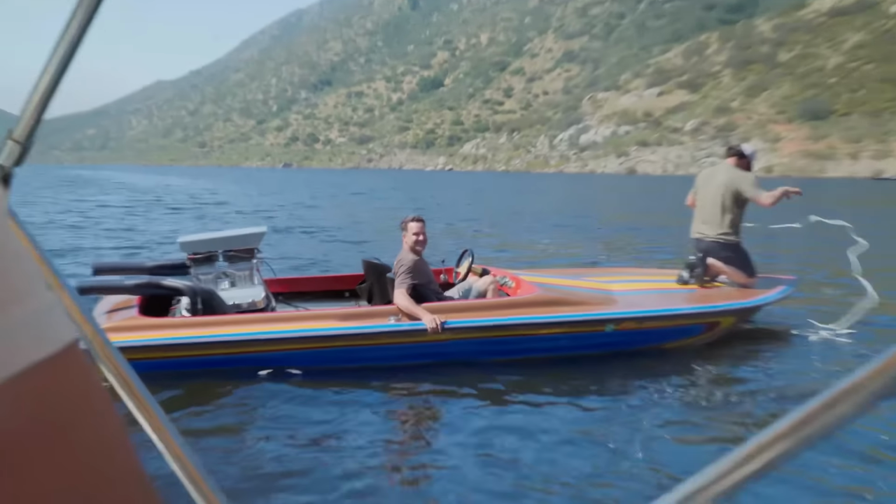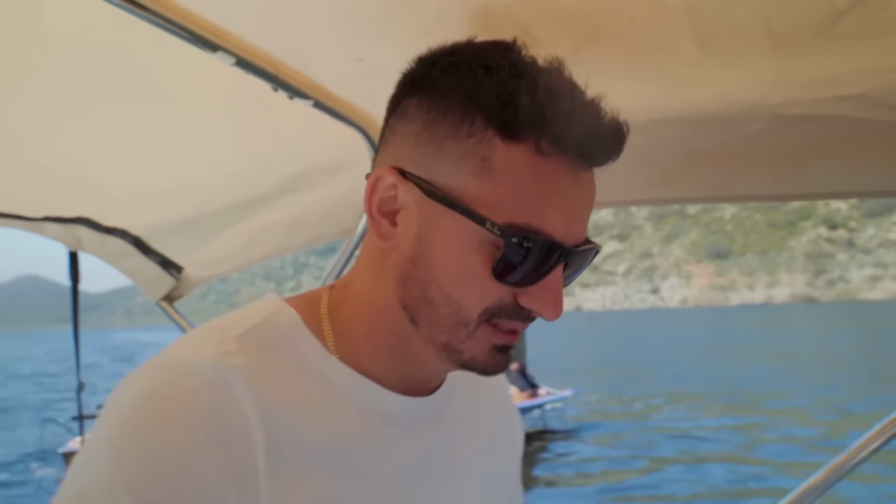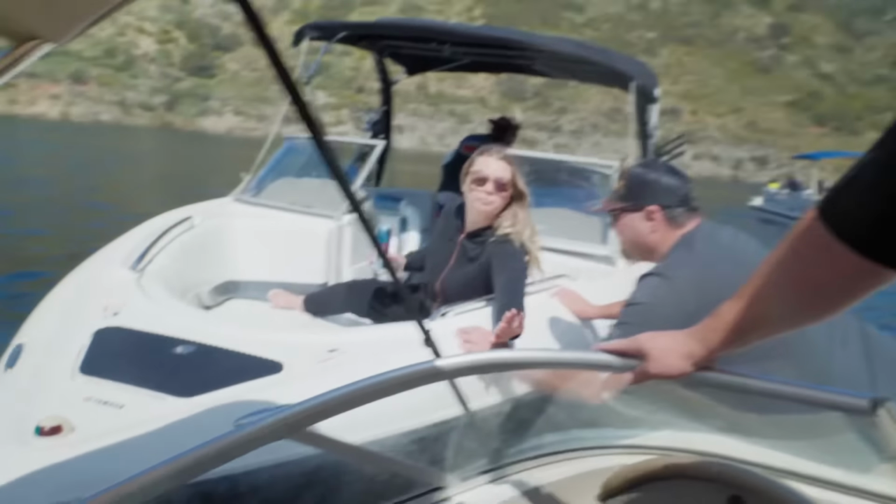It's a sleeper. So Travis, tell them a little bit about the motor. A lot of people keep asking me questions of what prop it has, how you did the swap, cooling system, everything in the manifolds. So you want to just explain that a little bit? Okay, it's an iron 5.3 Silverado 1500 truck motor, Gen 4 rods and pistons, flat top. It's got some ported 706 casting heads. It's a little small cam, Trailblazer SS intake, 92 throttle body. It's got an F-body T56 flywheel, which mates to the Mercury coupler. The regular bell housing bolts right on.